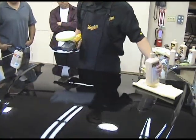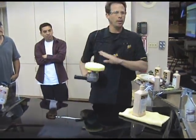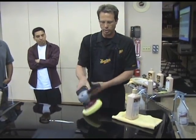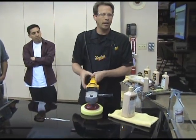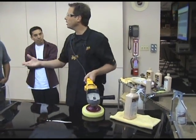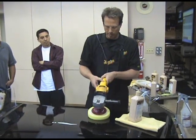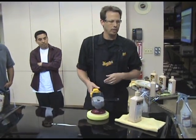So the process is essentially the same. We set our speed, and we're going to control our pattern. This is what I'm really going to get into working with this machine, but let's turn down our speed. I was at about 1800 on cutting. I'm starting to get this finish nicer and nicer, so let's turn down the speed. I'm going to be at about 1300 right now. Okay?